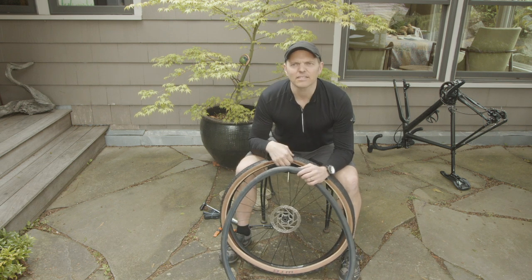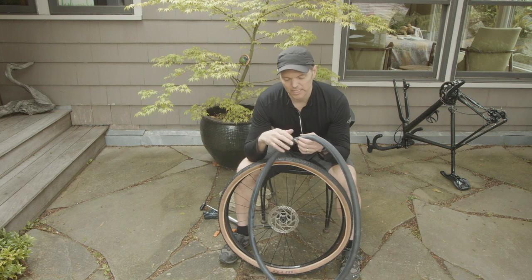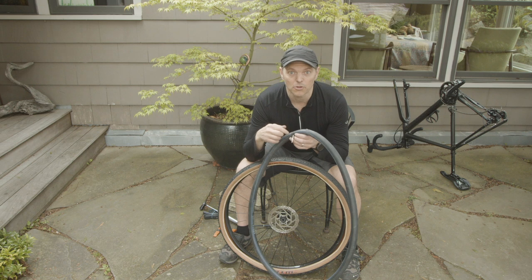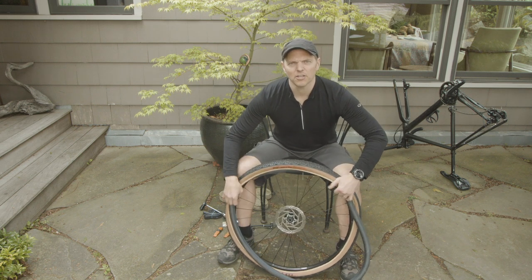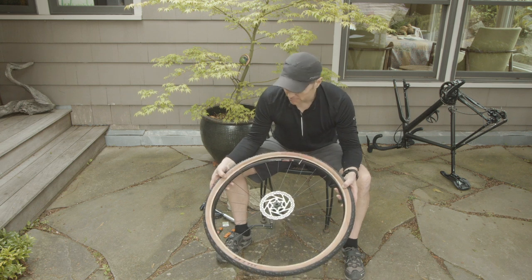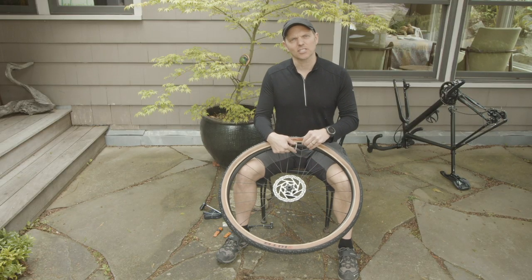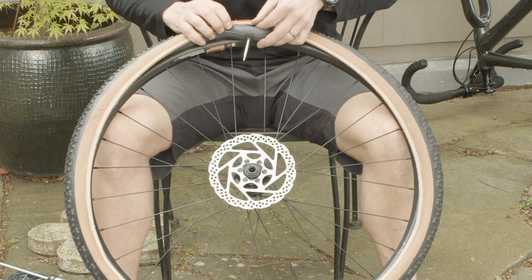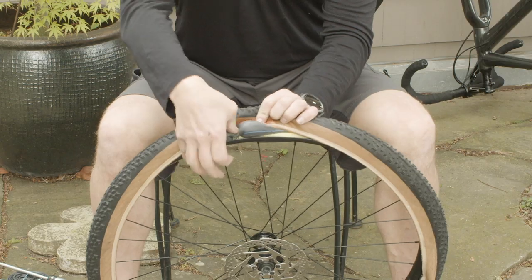Putting the tube back into the tire and back onto the wheel is a reverse of what you did before. You see there's still a little bit of air in here — I like having a little bit of air. Whether you're reinstalling a patched tube or using a new tube, you're going to want to put a little bit of air into it so it's easier to fit up inside the tire. If it was completely flat, it'd be falling out going every which way, but with a little air it makes it pretty easy. I want to line the valve up with the valve hole in the rim. If it's a long stem, it can sometimes be difficult to get it far enough in to reach the hole, so I might pull it a little out of the tire and get that valve started down in there.